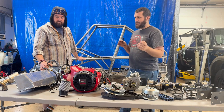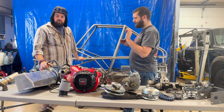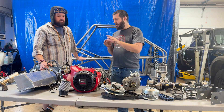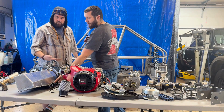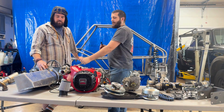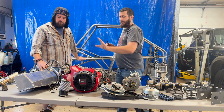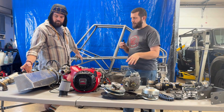That one went great. I actually ended up using eighth-inch aluminum for this whole tank rather than 0.093. On the fuel tank, we have a pulse pump, so the fuel will come out of the petcock and the pulse pump will pull it from the bottom of the tank, raise it up to the top area where the carburetor is, and deliver fuel.